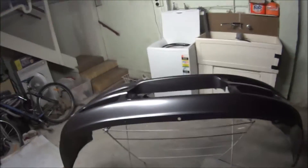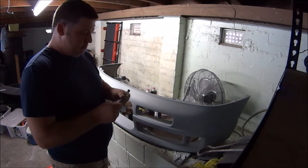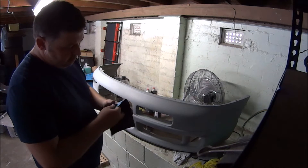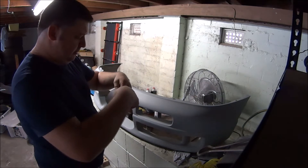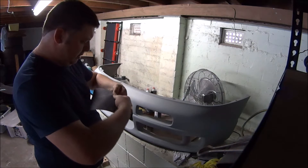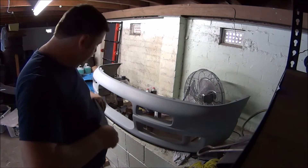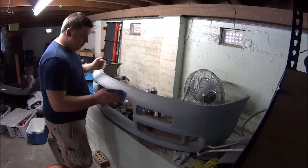Hi, I'm Tangles, this is my garage and this is my car. An hour later and a bit the bar looks good on the whole — it's decent, I'm happy with it. I'm going to give it a gentle rub down with some 800 grit to remove any impurities or dust that landed on the paint while it was drying, show up any other imperfections if there are any, and then put the base coat on.